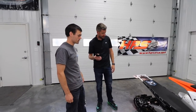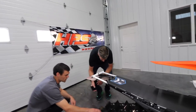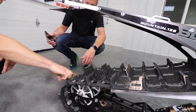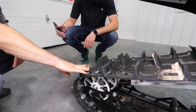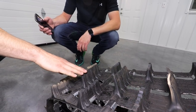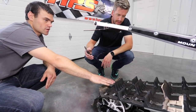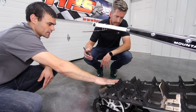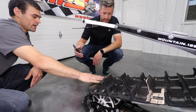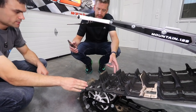That's a big reason as to why. So this year we're running a two and a half inch paddle track, and this is actually a hybrid of our last year track. You're getting a two and a half inch center paddle, but the outside lugs are two inches and they have a serrated edge on them. The serrated edge works really great in spring snow and on trails, but there's no doubt that a two and a half inch center paddle in deep snow is how you get up to the top of the mountain quick. It does give a little more rocker, but our track is unique in that there's no taper — it goes from two and a half inch flat to two inch. That adds more of a clawing edge, which for side hilling makes it bite into the corner of the hill. A rounded edge would want to slide downhill. This bites just a little bit better on the hillside. The track's still 12 and a half inches wide.